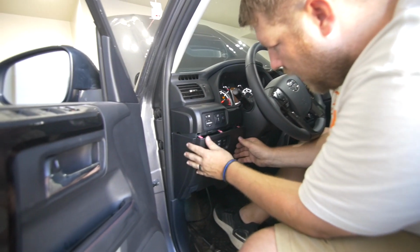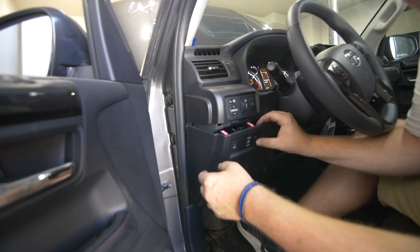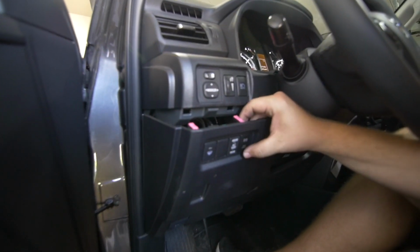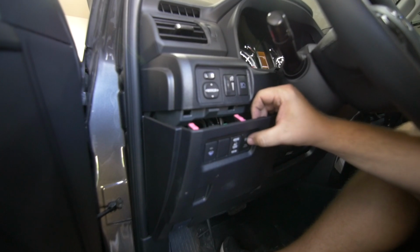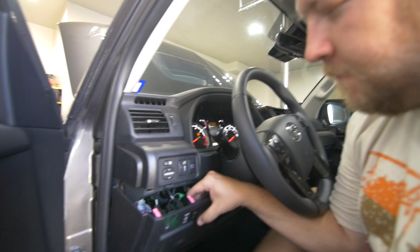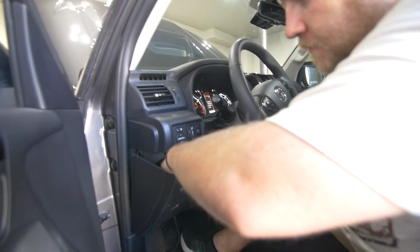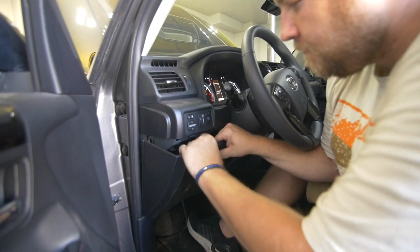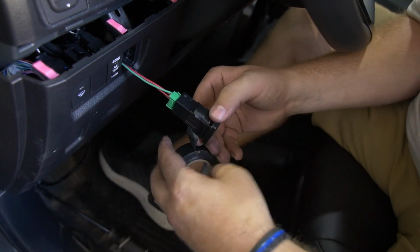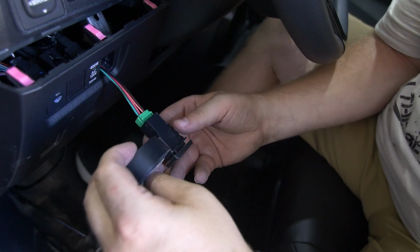That's it. And hold on, hold on. Test the light. Test the switch. So right now we're experiencing you press it and it won't lock in place. So what we might have to do is get some electrical tape and wrap it around the switch just to help it grab a little bit better, because right now it's just swimming in the hole. Couple laps. Yeah, just a couple laps around it. It just helps keep it in place so that way the switch will function properly.